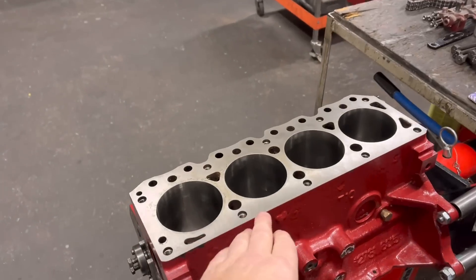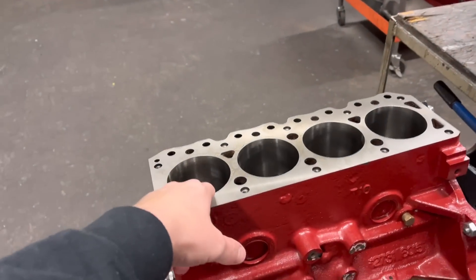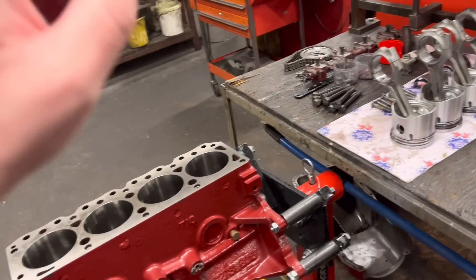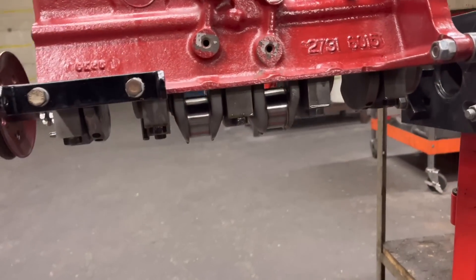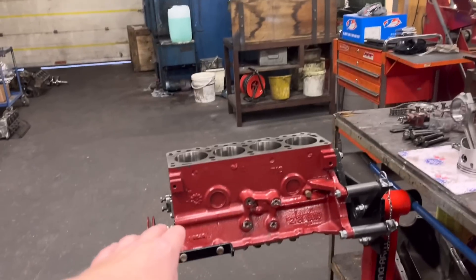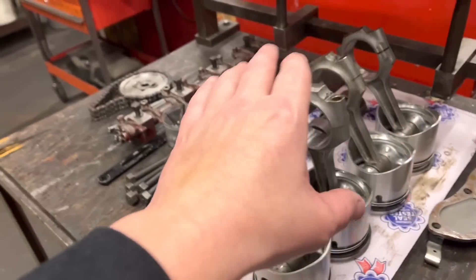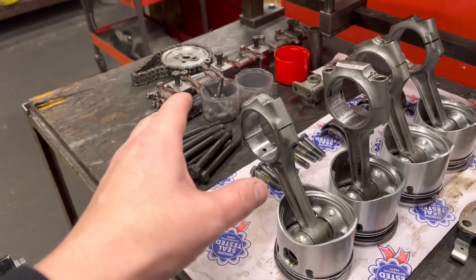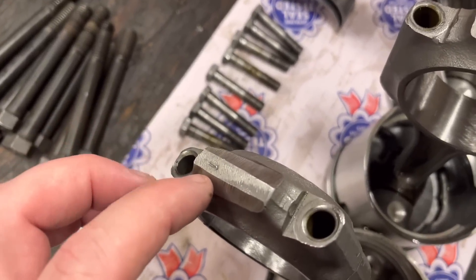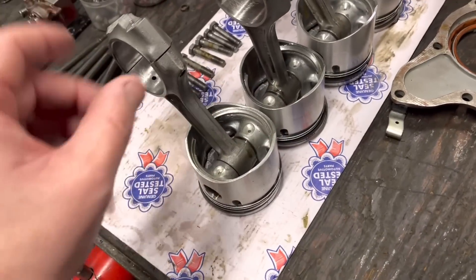Obviously we checked everything. The block face finish was not great, nor was the head face. But the bore measured perfect, so it's all been bored properly. Obviously new pistons - this thing's never ran. The bearings are all good. The only thing different is it's got steel main caps, which is good, so it's all been line bored. We've checked all the tolerances, everything's great. The crank spins freely and all the rods have been sized. Now when I went to check the sizes of the rods, Isaac, when he took them out, stamped them one through four, one being at the front. So this is exactly as it's come out.